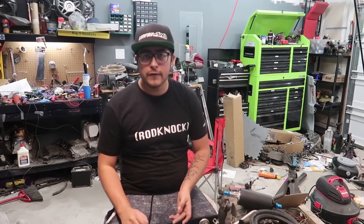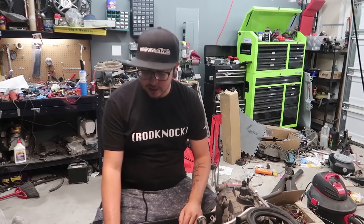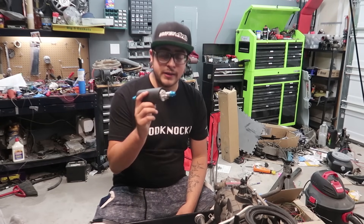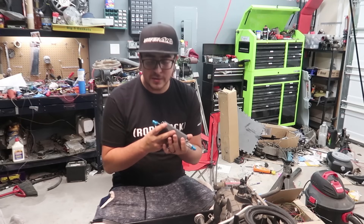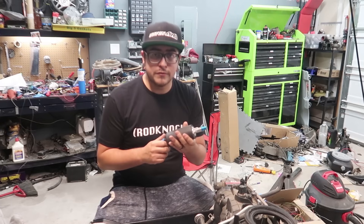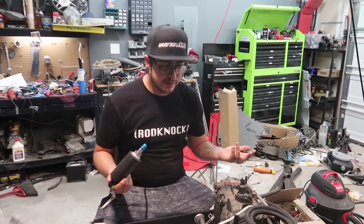I hope that clears up a little bit of the air for you guys. I know this is a little rambly but I'm trying to make these videos to appeal to beginners. My word is not gospel — obviously I'm running the bare minimum requirements for an LS system. Fuel pumps are not generally something you want to skimp on, but I have had good luck with these. If you're scared of your fuel pump dying or if you're running boost, make sure you have a reliable fuel pump because you don't want your motor running lean. Take what I have to say, spend extra money on better parts or run what I have and err on the side of caution.